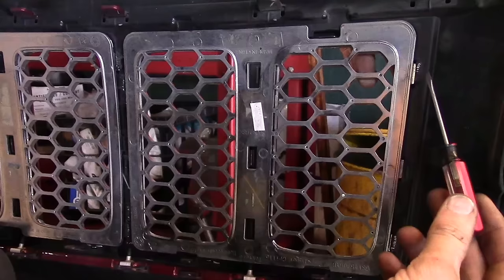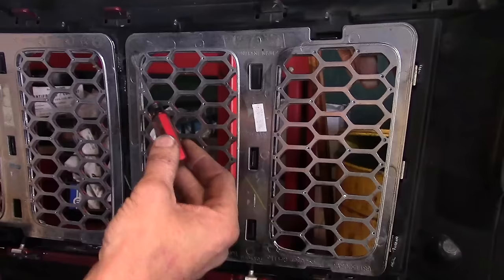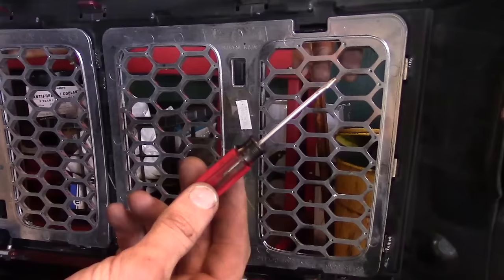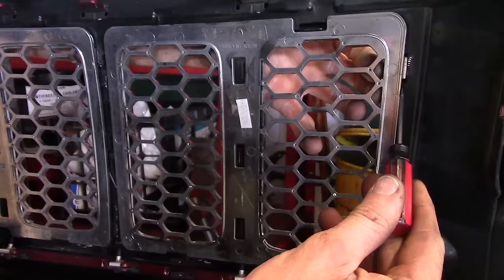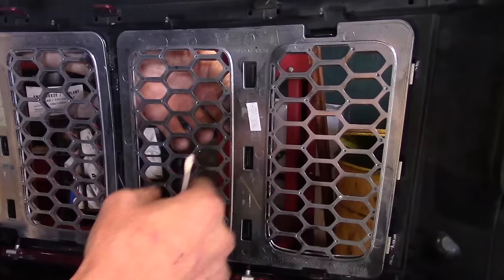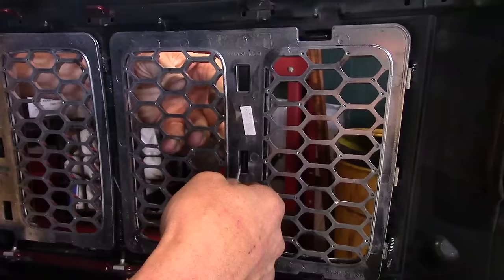There are little catches or fingers all the way around the perimeter — these are what we've got to release to get this off. I've got my hand on the front side so I can push as I do it so it doesn't want to reseat. What I've found works best is a small pocket screwdriver or small flat-tip screwdriver. Get in between the latch portion, do a twisting motion at an angle, kind of prise it and work your way down. The center is kind of staggered — it latches one way, then another direction, so just look at it and figure out which way it goes.